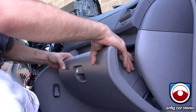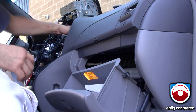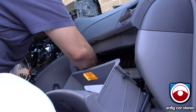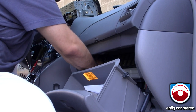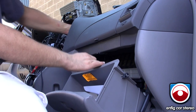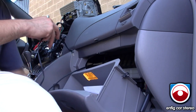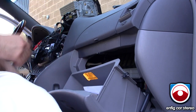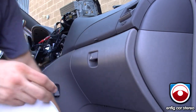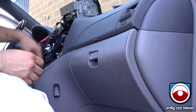Now you have this cable to run. With the glove box, all you have to do is there are two hinges right here — just squeeze it together a little bit and it drops right down. To run the cable, just reach your hand back here — you can just feel it right through. My fingertips are actually touching right now and I'm not even looking. If you took your time and looked, it's even easier. You can leave it hanging out right here, or guide it down here, and have this cable nice and easy.